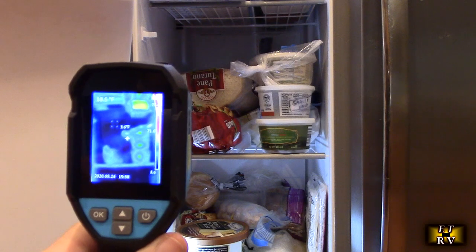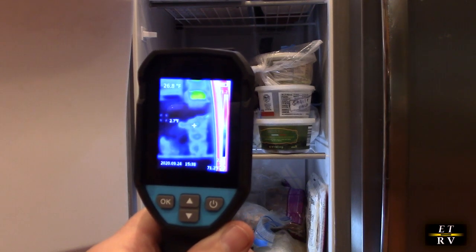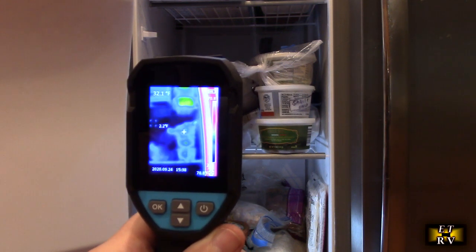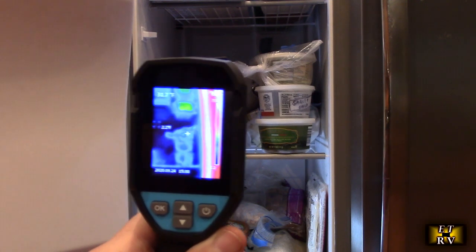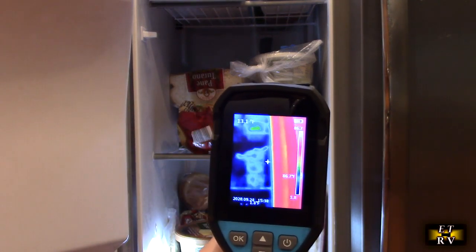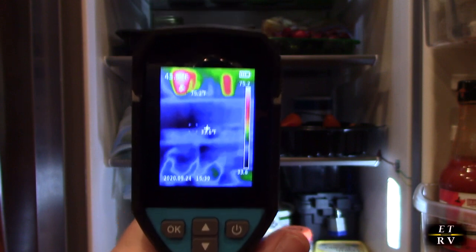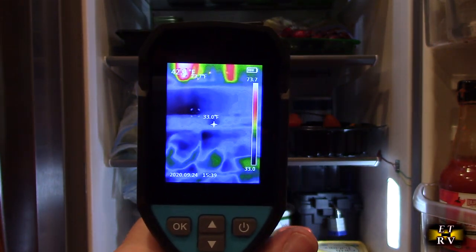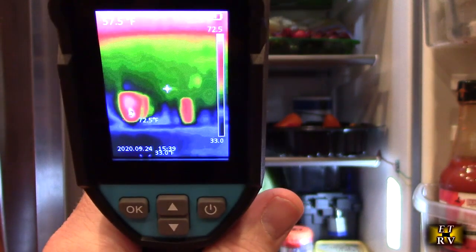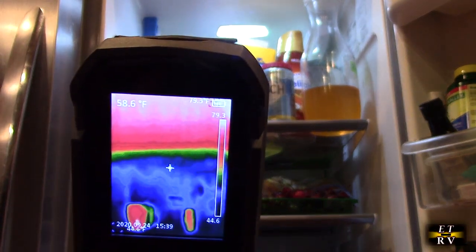Here's the inside of a freezer — it had the low temperature warning because it's sensing cold. You can see it's showing about 3 degrees Fahrenheit. If you have a freezer problem and want to check the temperature, this will show you. The color is blue inside, and as you move towards the handle it goes red because that's the warmer outside. The refrigerator is displaying 33 degrees, and as you go towards the top the temperature rises because of the LEDs and rising heat.